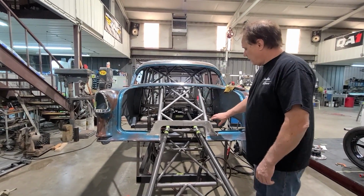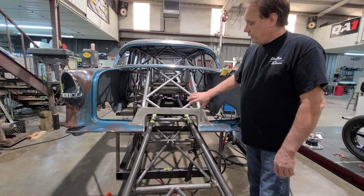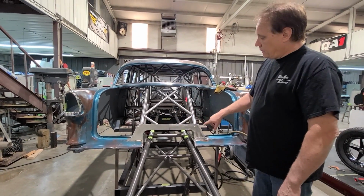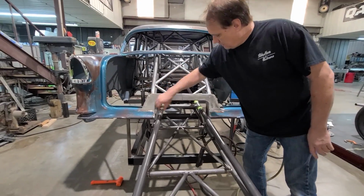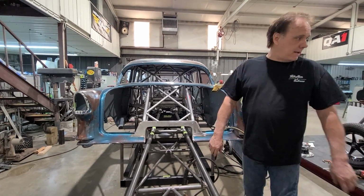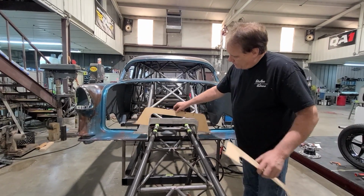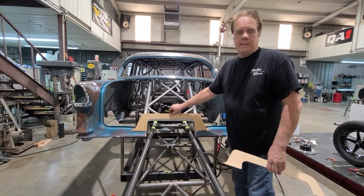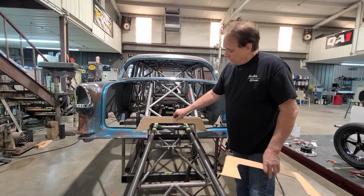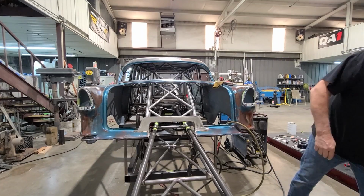that's coming next. What I did was, instead of just cutting this out, where each side of this will be welded to the frame rail so it'd be strong enough, and then cutting a chunk out of the trunk lid, I wanted to continue the theme of the rear pan all the way around, and I'm in the middle of that process right now. So I took some masonite and made a couple different patterns. The first one I made was a little taller. I decided I just didn't need that much height, that much clearance, and that may be a mistake. The second one was a little shorter, so I went in between and made this one out of steel,